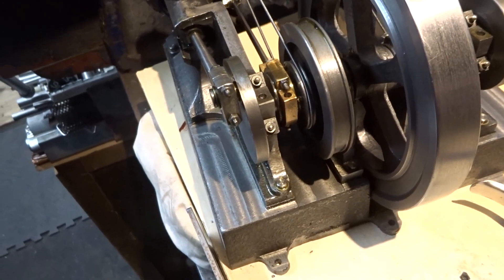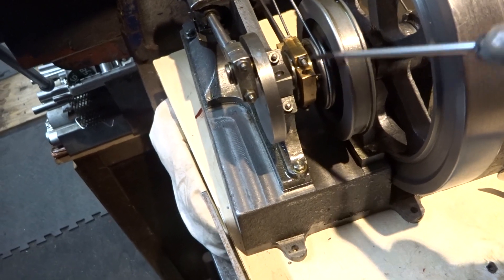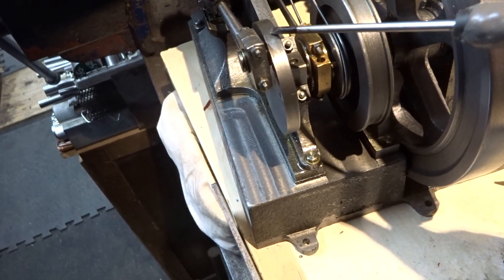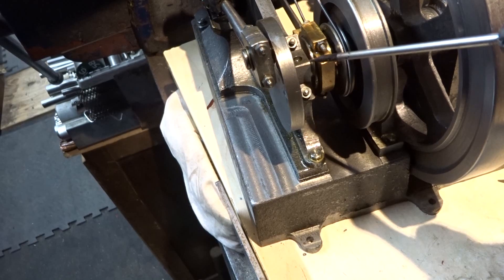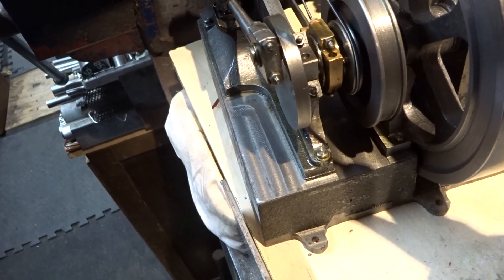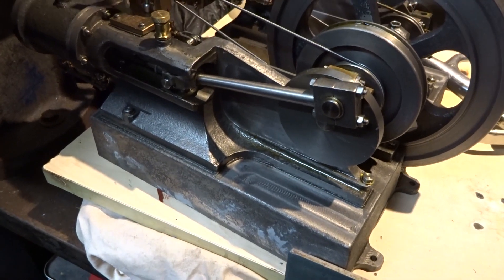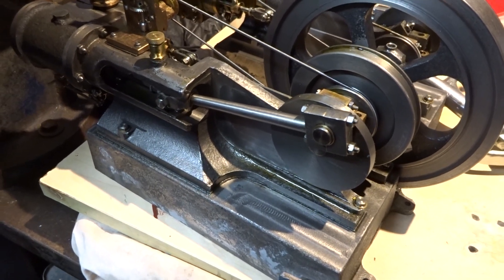One of the features of the engine is the big end lubrication. There is a hole drilled through the end of the crank to meet a hole in the end of the crank disc which has been blanked off. The idea is that the oil goes into the big end and is thrown up by centrifugal force to actually lubricate the big end of the conrod — which is quite a neat idea really, and not difficult to do.